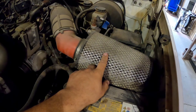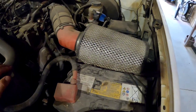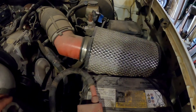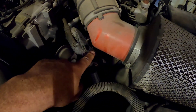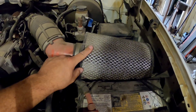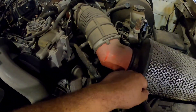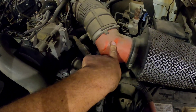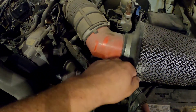We've already went and put this 6673 cold air intake air filter from NAPA. We built a nice little elbow for it. If you haven't done that to your truck you need to do that to your 7.3 already — a piece of four-inch pipe will let you build one of those real easy.